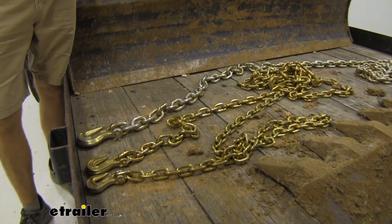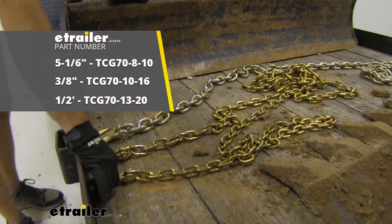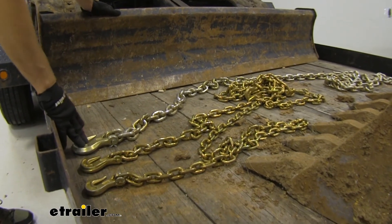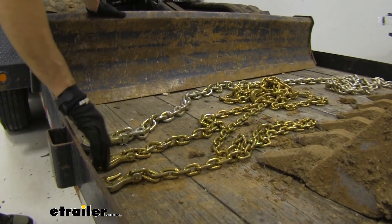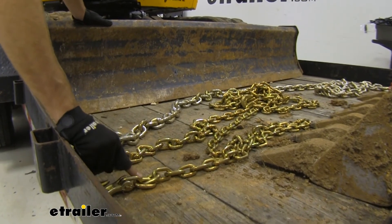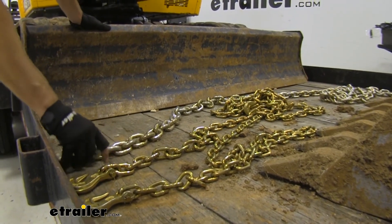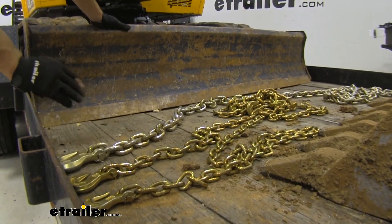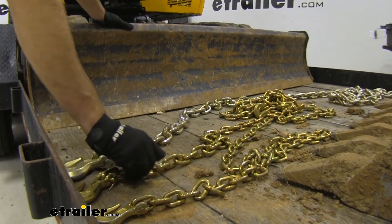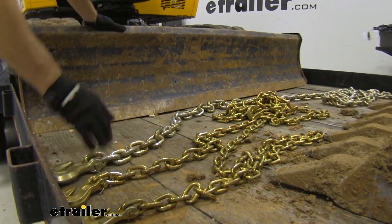When it comes to choosing the right size chain, it all depends on your load and what you haul most often. Here are three common ones: a 5/16ths, a 3/8ths, and a 1/2 inch, and they come in all varieties of lengths. Usually the 1/2 inch goes 20 feet and up, where the 3/8ths and 5/16ths can be down to 10 and 16 feet. This style from Titan Chain has about a 4,700-pound working load limit; this one's 6,600 pounds; and this one is 11,300 pounds. If you're using your chains in the right configuration — one at all corners with a boom — you can get away with a chain that doesn't by itself hold your load, because working those together gets that working load limit up.